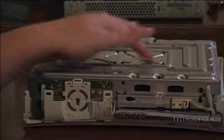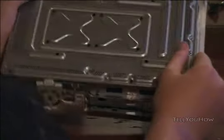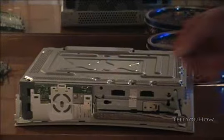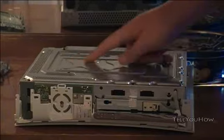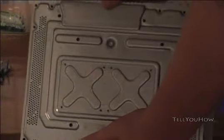Now you're going to take your screwdriver and undo all these screws. The middle black ones are T8 — that's where you need the T8 screwdriver. Everything else you can use a T10. There are like 20 screws total, so remember to use the T8s on the inside X-clamps and the T10 everywhere else around, or else you may end up stripping your screw.